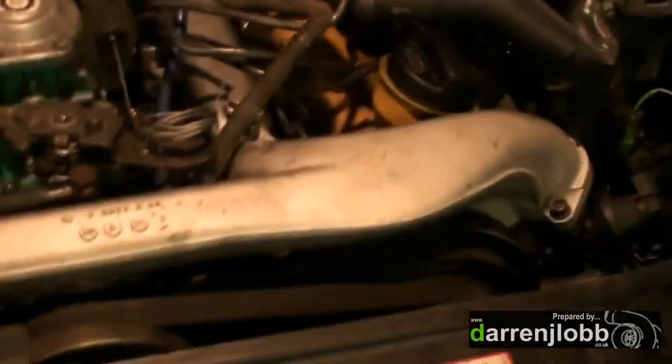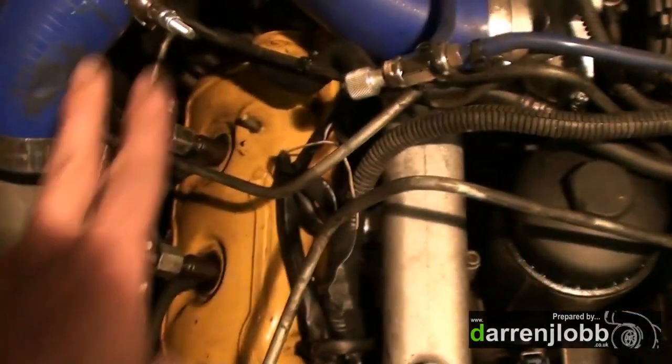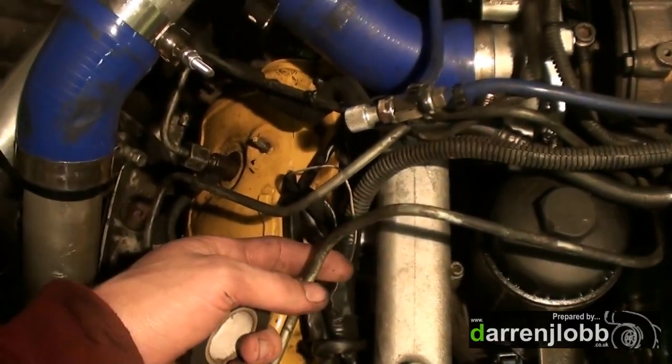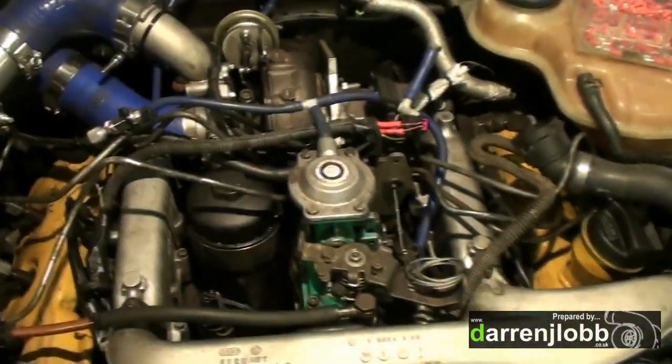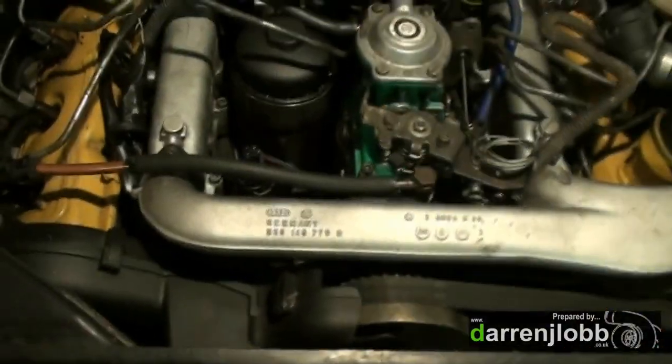We might actually have to lash that in chemical metal just so we can fire up. I'm just doing a little bit of wiring here - this little oil manifold has got an oil pressure and an oil temperature sensor. It used to be located over here but all the wiring on the loom doesn't reach, so I've just extended all the wires across. I won't leave it bare - we still need those fairly important warnings inside.